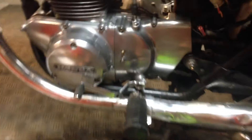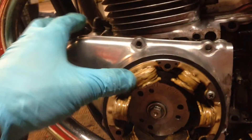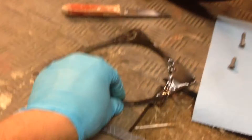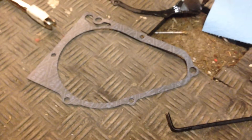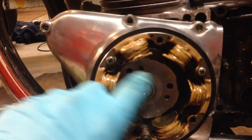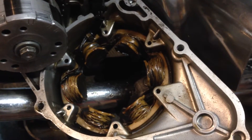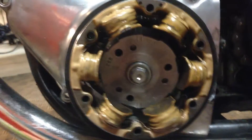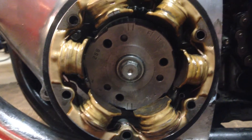I will do some other videos as I go along. So now I'm at the point where I've taken things apart. You have to take off your clutch cover and you have to take off this part here. You may or may not have to replace your gasket — mine is not so bad, I probably could have reused it but I just happen to have a good spare one. To take off your stator, you can see these three screws right there simply hold it in. For reference, this is the back side of the original stator — there's the front — and you can see the timing mark up there.